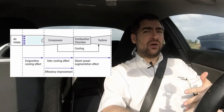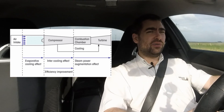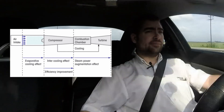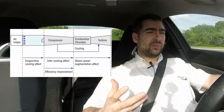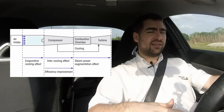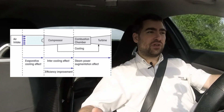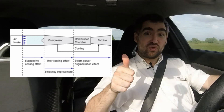So what if you could take the heat out in the middle of when the turbocharger's compressing it? The air comes out at 120 degrees instead. Then some magic happens — the air is more dense going through the turbocharger, so the turbocharger has to fight the hot air less. It takes less power. Not only will it spool faster, it'll also take less exhaust pressure to maintain boost pressure. But it only works if you inject the water into the throat of your turbo, into the inlet. Because once the turbo has generated all that heat and compressed all that air, it doesn't really help the efficiency much. So you have to spray before the turbo.